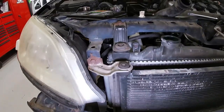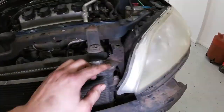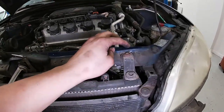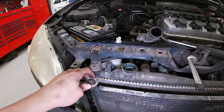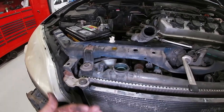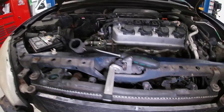These are the brackets we'll be undoing for the AC condenser — 10 millimeter on each side and those little brackets come up off there. Same for the radiator: 10 millimeter on each side and those brackets come off. Then we'll be able to lay the condenser forward just a little bit, which gives us room to lean the radiator forward and pull it up and out of there more easily.